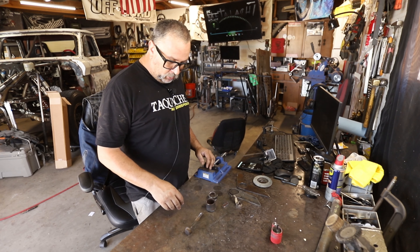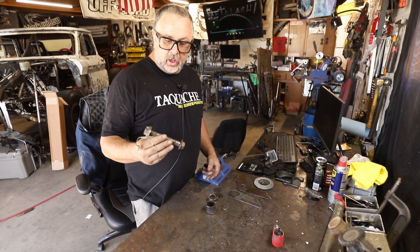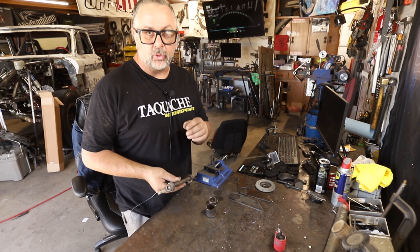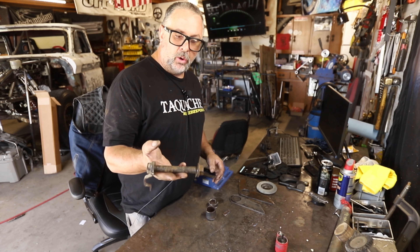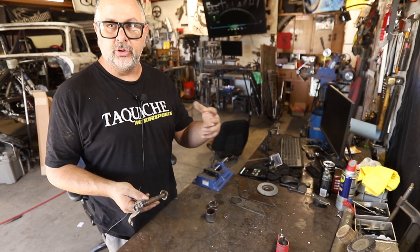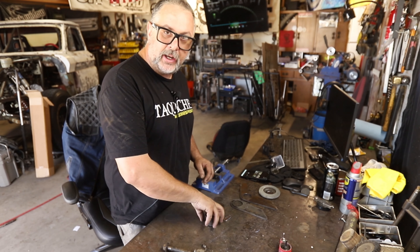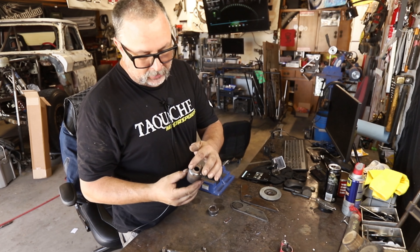What I've done here is I've taken the bolt assembly that holds those lower control arms on. A lot of places, if you can help it, try not to replace these bolts because the factory bolts are pretty hard compared to grade 8 or even grade 10. So if the bolt is not in bad shape, try to retain them unless you're opening the holes up for a bigger bolt. These have a nut lock on them already. What I've done is I've created a new pivot hole — I took a piece of tube and basically cut my own washer to fit the bolt.